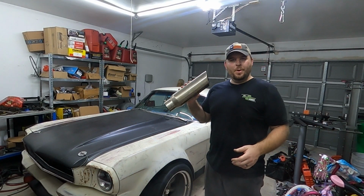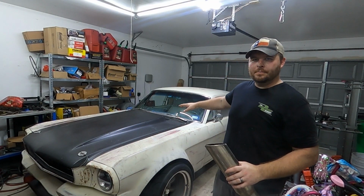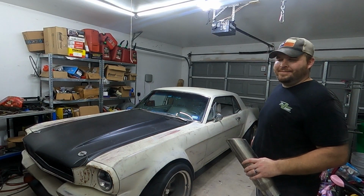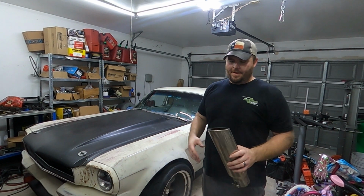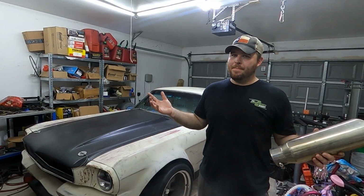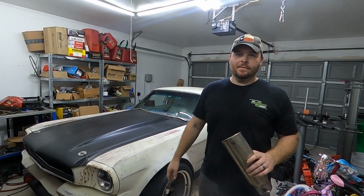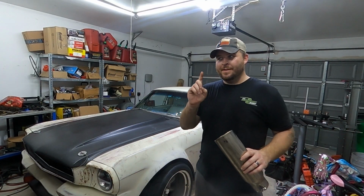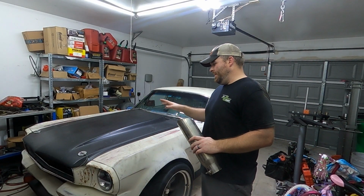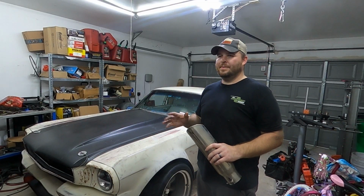So no more of this show car stuff. Who needs exhaust tips? Okay, we track car. Now we got the raw pipe straight out the side, both sides. One, we saved some weight because we eliminated some piping. And we simplified the exhaust. We kept the muffler, so that way we maintain the status of an adult Coyote owner. It's not straight pipe, it's not crazy rasp.